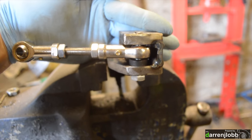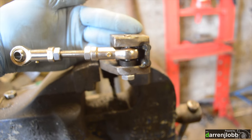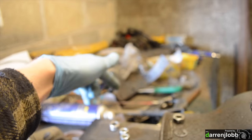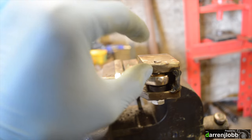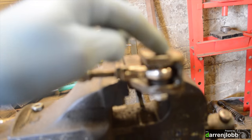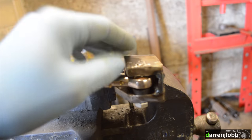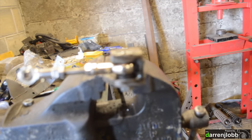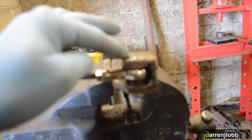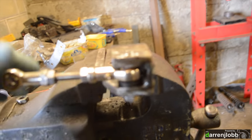Only slight concern will be whether or not it still fits in the car. I've hopefully been measuring it as I've been going along. I haven't actually trial fitted this bit, but I've been putting the bracket back in and visually looking at it. I'm pretty sure we've got clearance. The tightest bit is at the bottom here, so I've actually threaded the plate rather than putting the nut on the back side, because you'll never get in there. The plate is thicker than the nut anyway, so there's plenty of threads there. That tightens down nice and tight and gives us the full travel of the rose joint without affecting anything else. Hopefully that's still going to clear at maximum travel against the bulkhead — worst case we may have to clearance it ever so slightly on this corner, but I think we should be good.